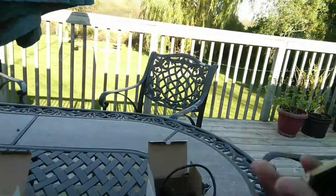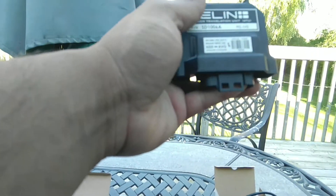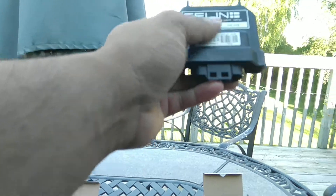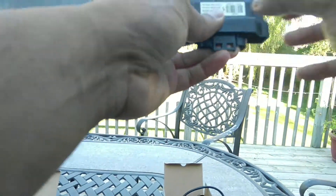Now, the kit itself is very high quality — they are pretty much the only ones that make it. In my kit I have two options: Add and Average. People who have a dual pro-charger kit but don't have a standalone ECU, or an ECU not tuned for the kit, need to go to the Add setting. On the standard Add setting, it takes the reading and divides the airflow into two and sends the ECU the combined signal.